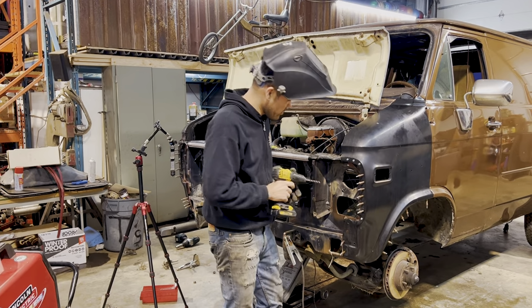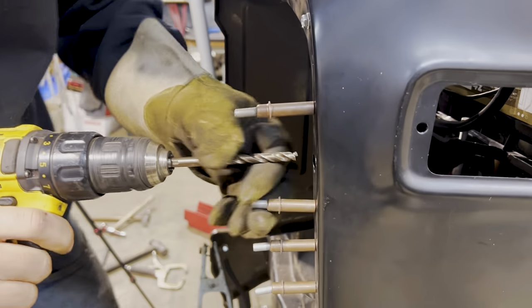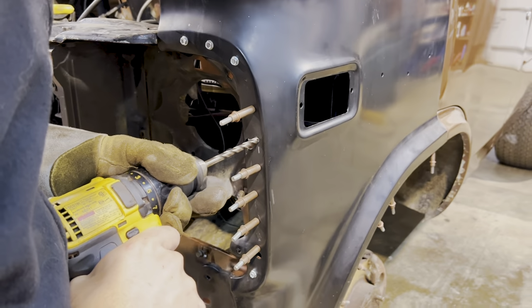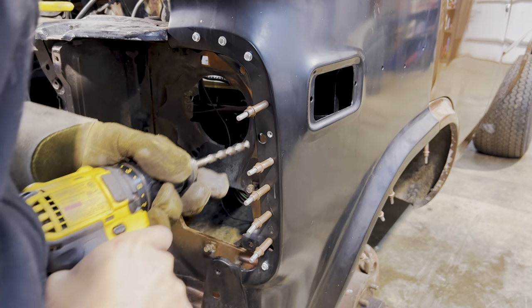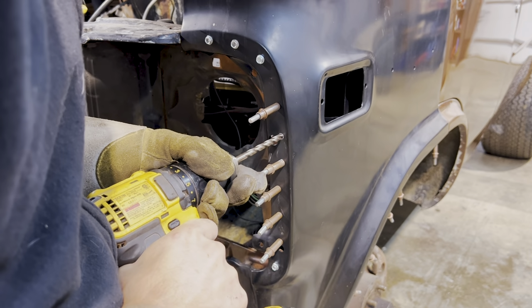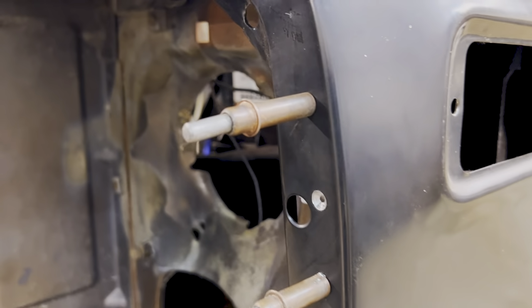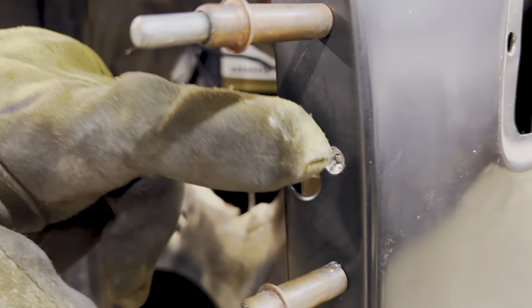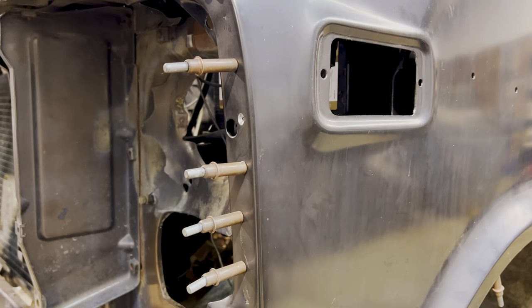So basically what I'm gonna do, like I said, is I'm gonna pop one out. I'm gonna drill the first layer. So you see it through to the second layer. It also has the hole still in the center. For guys with just a 110 volt MIG welder, this is the best way to ensure that you are gonna get a good penetration spot weld.